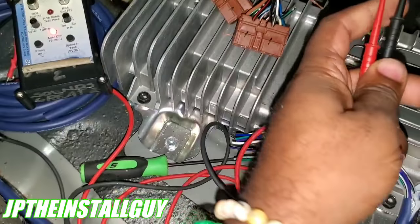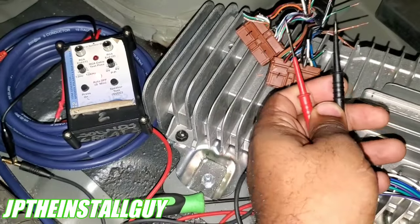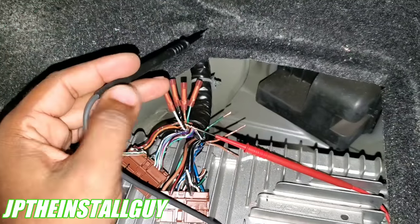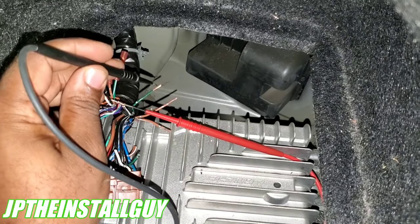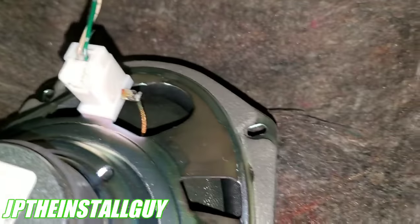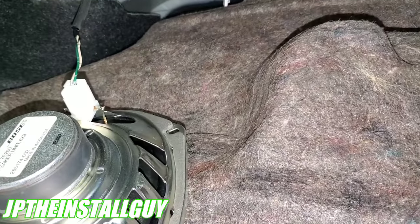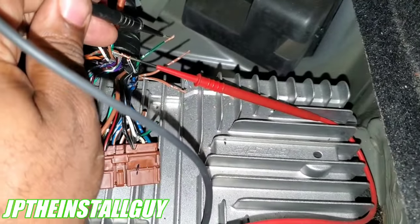The phase tester has little leads with clamps. I clamped two of my multimeter leads onto them so I can come over here and test my wires. I got one wire wrapped around my red lead and this one on my green, with the black on my black. And now we hear it — it is popping that speaker. If you're actually changing the speakers out, you can look at the wire color on the speaker, then find matching ones at the amp and confirm them using the phase tester. I found white with black and green with black — as soon as I hook that together, it starts popping that speaker.